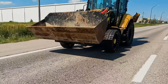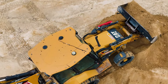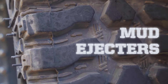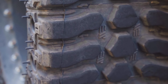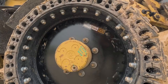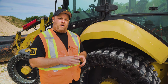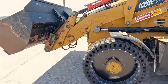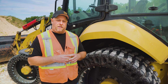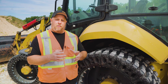We also added enough void space so that the tire still has good traction in the mud, and the feature that really helps is our mud shucking technology. We put mud ejectors in the middle with raised bars, a raised logo, and side traction on the side of the tire so that as you're going through mud that side of the tire is still getting traction. What you don't see is that this mud shucking technology also adds surface area to the tire to help with heat dispersion at high speeds. Solid tires are known for building up heat, and all those extra features allow the tire to disperse that heat for more stable thermal conditions.